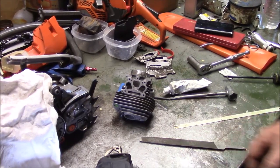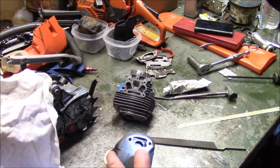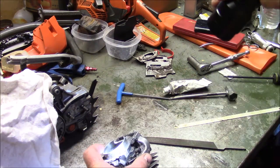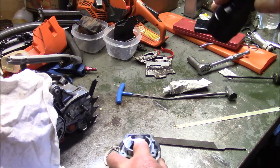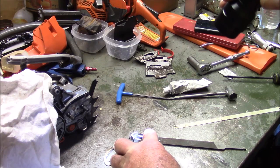So to summarize, I opened up that on the inside fairly significantly, I trimmed the flange, and I lowered or raised, I guess, depending on whether you have it right side up or upside down, I raised that area of the transfer, the entry to the transfer ports, up by about 100 thousandths.